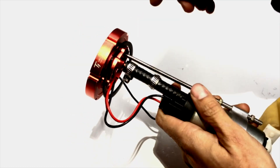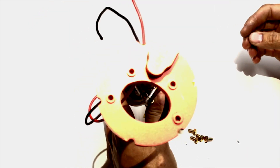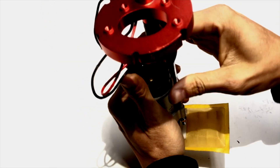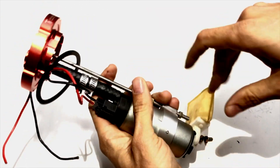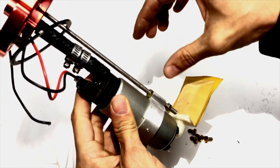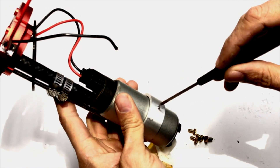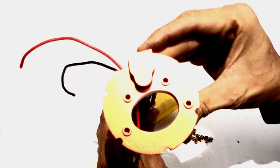Once you have all that done, make sure you have your pump oriented correctly — because of the way the fuel tank is set up, you want it facing this way. Then go ahead and tighten up your set screws down here. You can fully adjust the mount with your screws. You have set screws — one, two, and three — tighten those up with a small Allen key, and you're pretty much ready to go.